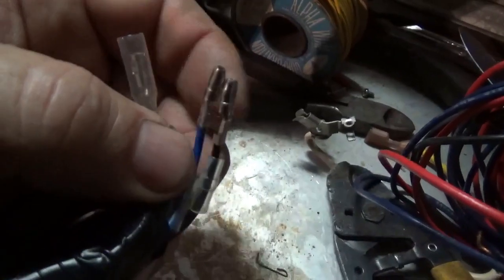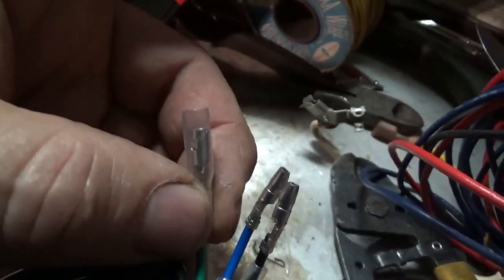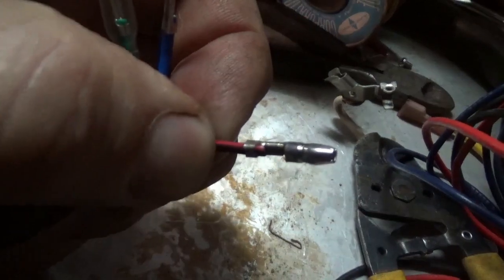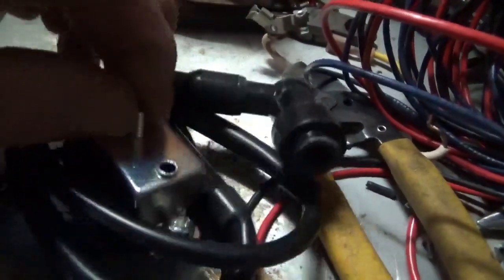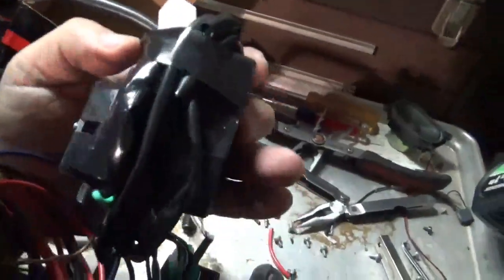That only leaves you three more connections. The blue wire needs to go to the pulse generator — remember I showed you there was a blue wire. This green wire you actually have to split: one goes to the pulse generator, and the second wire from the green needs to go to the negative of the battery or the ATV frame. And this black and red wire needs to go to positive 12 volts. The cap goes on the spark plug, and this coil bracket has to bolt to the frame.